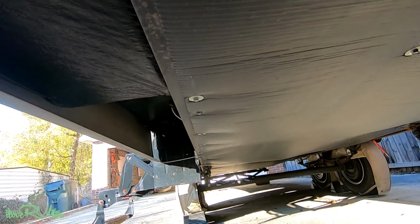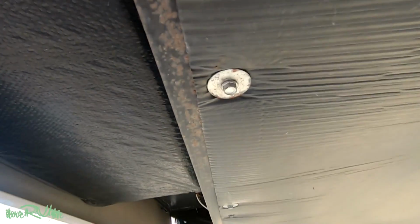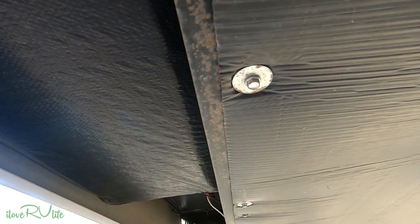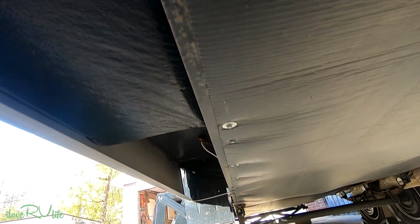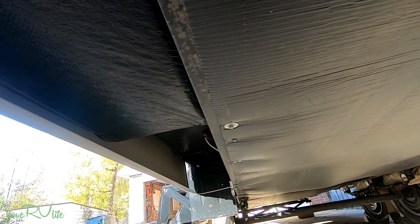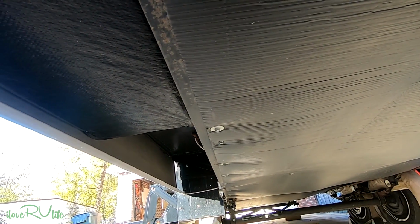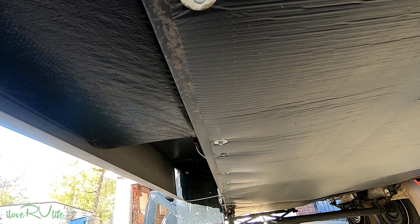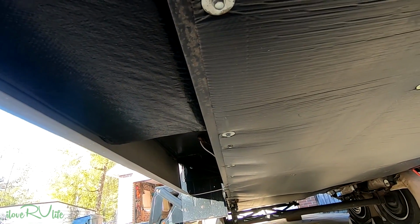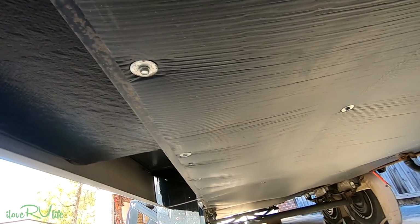You don't have to take your whole black pan down, this protective pan that's used to keep weather out from underneath your camper. If you'll notice, you have these bolts. Most of these have a bolt here. I just took an electric drill with a 3/8 adapter, and I just popped them all off down one side. That probably took about an hour, maybe not that much time. And then I ran the cable up under this. There's actually a raceway. There are these bars where you can see other electric wires that are running, both 12 volt, etc. And I just ran that cable straight down the line and then came right back and popped all these screws back in. I didn't show that on the video. It really wasn't too difficult, just a pretty basic task.